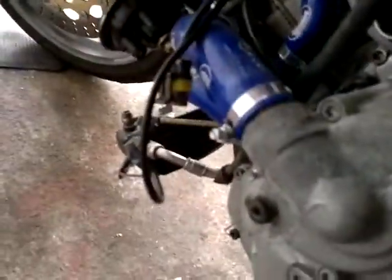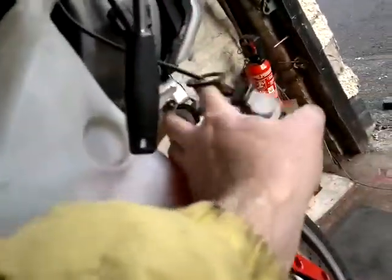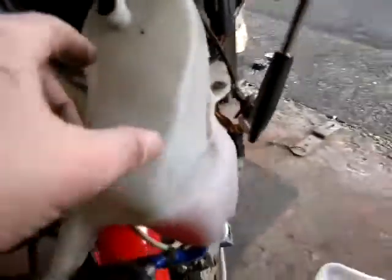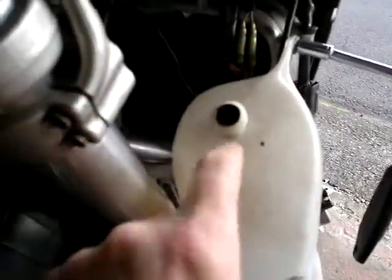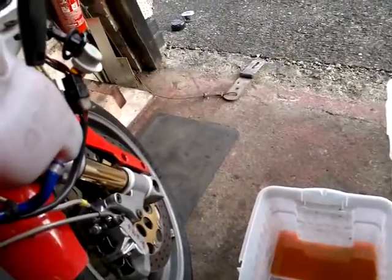Hi, that was taking too long so I've put the plug back into the water pump and I'll do it too. That screw — an 8mm headed screw — and that screw off, and I'm going to pour the water out of the expansion bottle until there's nothing in it basically. And I can take the cap off the radiator, then I'll take that back out and it should drain out a bit faster.